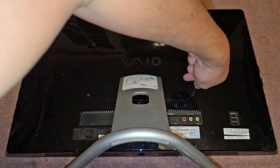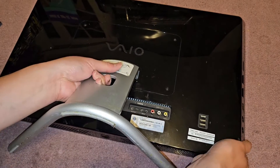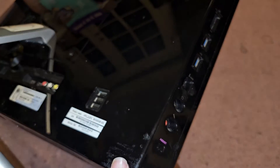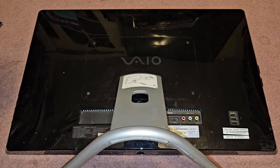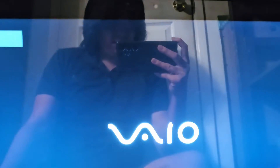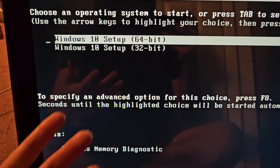Alright, and that's pretty much it. I don't think this has the special button — let me see. Oh, it does! It has the assist button. So you power it up and then press the assist button, and you should be able to start it up. You do need a Windows USB installer, so keep that in mind. Alright, moment of truth — let's press the assist button. Got it. It's turning itself on. There we go — it's already booting from my USB, and we should be good. We just got to install Windows now. So that's pretty much it. Thanks for watching and I'll see you all in the next one. Bye.